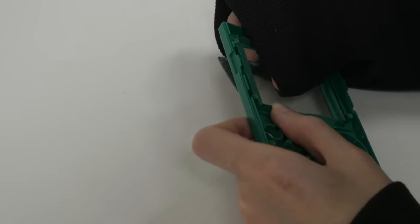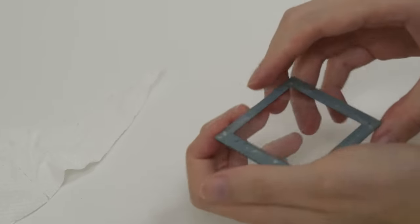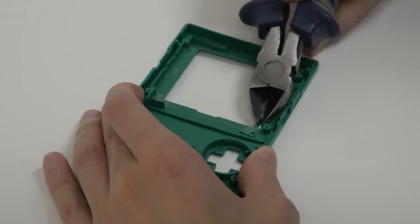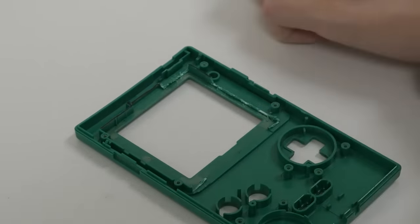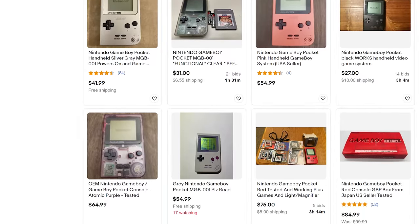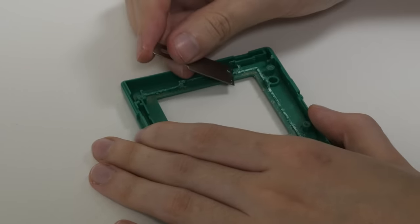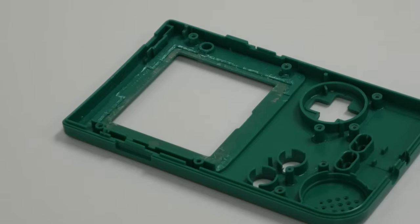I removed the front screen cover — it's often called a lens, even though I'm pretty sure it doesn't have any actual optical properties. It's stuck on with essentially some tape, so removing it is as simple as carefully pushing it out. I don't think this is strictly necessary for this mod, but since we'll be cutting and shaving the case plastic, it'll make it easier to keep everything clean. First, I'll use some cutting pliers to snip off the big chunks. If you're anything like me, you do feel just a little bit guilty doing this — some mixture of this being an original part from 20 years ago no longer in production, with some fear that you're gonna screw it up. Also it's kind of a collectible, and modifying it could reduce its value, but I don't think that really matters unless I was planning to sell it. After snipping off the large chunks, I used a chisel edge razor to file it down flat. You can also use a Dremel, which would certainly speed things up, but the razors are fine as long as you're patient. Eventually the case looked like this — not the neatest thing in the world, but it actually looks a lot worse than it feels. It's pretty flat to the touch, and I think the screen should sit pretty flush.